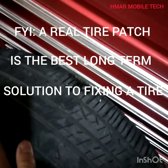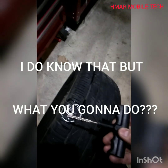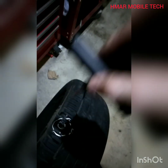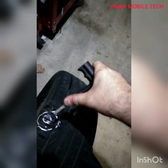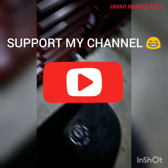This is a good candidate for a plug, so I'm just going to rip that nail out. With this reamer tool — I've already done it — you'll stick it in straight. You don't want to go at an angle; you want to go straight in. Push it down only about half of the tool, maybe about an inch, and then go in and out a couple of times just to give the hole a rough edge.